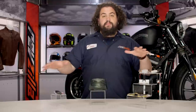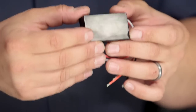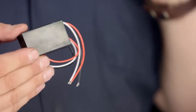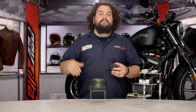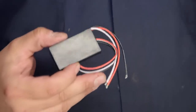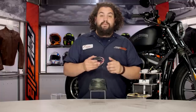So let's get into some of the ones we have sitting in front of me. The first up is a fairly universal piece — it's a tail light strobe modulator. What this is going to do is make your tail light, after this is wired up, stutter every time you hit the brake. You're going to see a strobe or a modulation effect, which is great for grabbing the attention of somebody behind you who might be distracted — somebody talking on the phone, somebody texting away. A lot of times they might not notice that your brake light has just lit. However, if it's lighting repeatedly and in a strange fashion, it's usually enough to jerk them out of their daze and make sure they don't hit you.